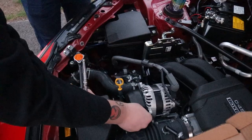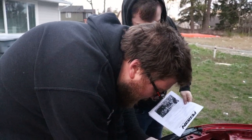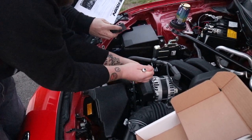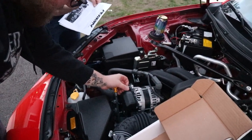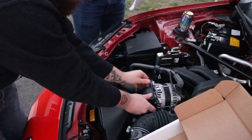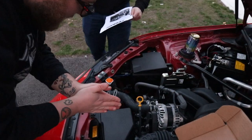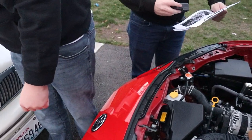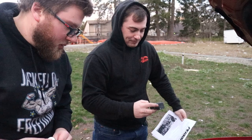It says you want to pull your air box out, and it's very cold, so I'm probably going to drop a bolt. Everybody judge Chris for dropping bolts — like that show, Everybody Hates Chris. Plastic cover from alternator removed. Now how do I pull the belt off? Install a 14 millimeter wrench onto the automatic belt tensioner and rotate enough to remove the serpentine belt from the alternator pulley.